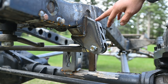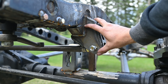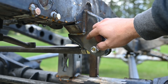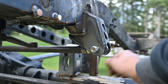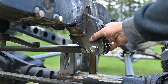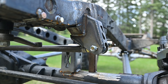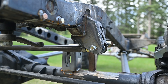So you're going to see the panhard bar mount here — this is all pretty well the stock shape of it from TMR. What I did to make it work is I had to make a frame piece to jut out to drop this down to get my bar level. If I wouldn't have made this frame piece, this whole bracket would have sat up another two and a half inches higher, and then this arm wouldn't have been on the same level as my drag link.